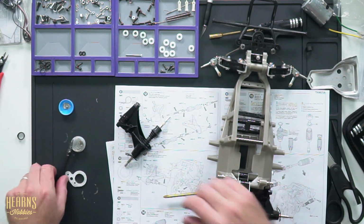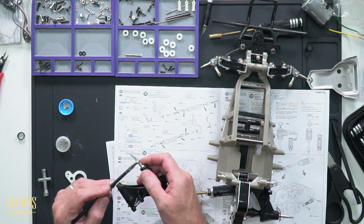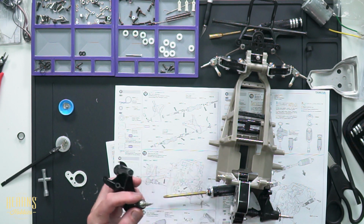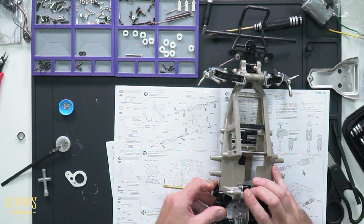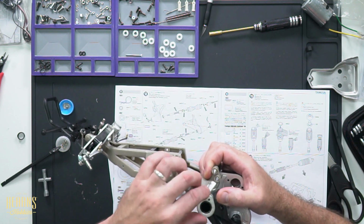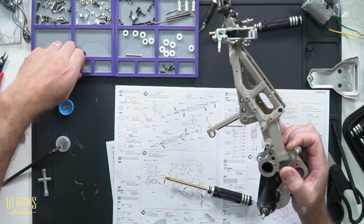All right, so let's go ahead with the other side. I'm going to grease this out drive up. This one here has the pin that runs all the way through the diff, so ensure that that spline's got plenty on it. Like so. Offer this up, should be straighter now. Yep, it's going straight in like I was hoping. A little bit easier when it's all lined up. 2 more screws, and that is the rear axle on.